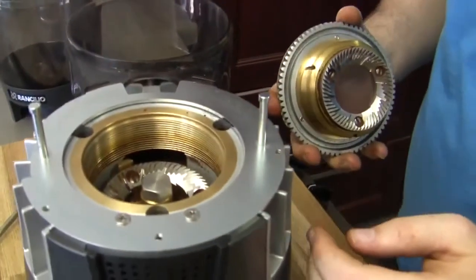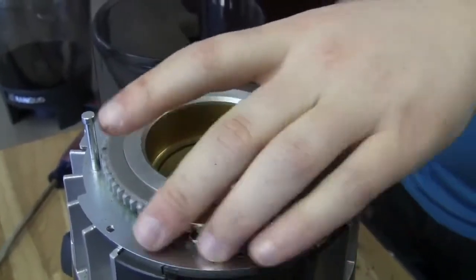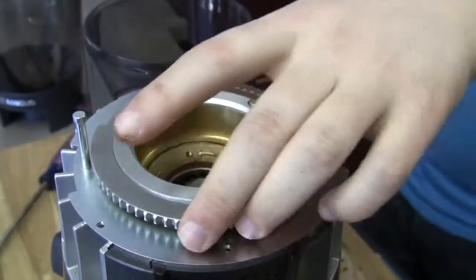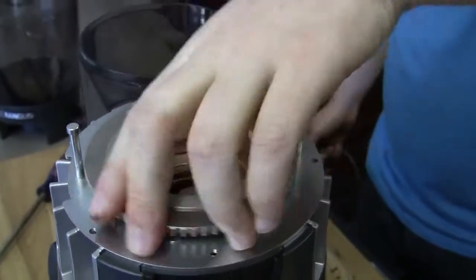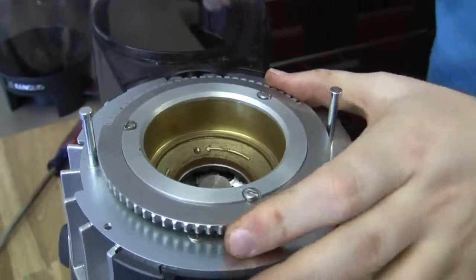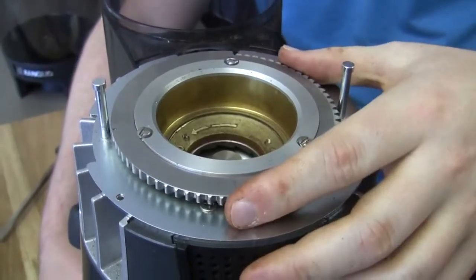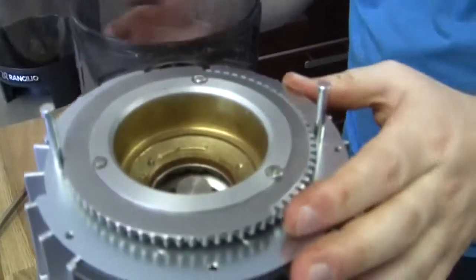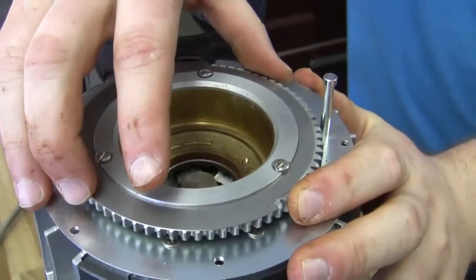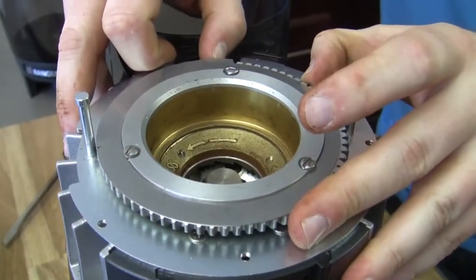Now show me how to get it back together again. Going back together it's a matter of spinning forever and ever. If you haven't watched my other videos on this, the big thing to remember is you just took it apart — we've got to put it back together and hopefully get it close to where we want to be. You can see right there it tightens because they've bound together. So I need to be a little less than that. I'm going to plug it back in and start it, going down until I hear those burrs touch. Right to there — that's where they're just physically touching. That's too fine, way too fine. So we want to coarsen it back out. General rule of thumb: we normally aim for about eight notches or so.